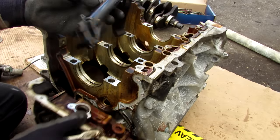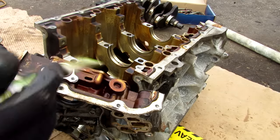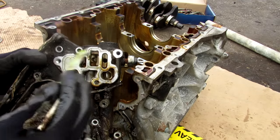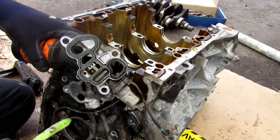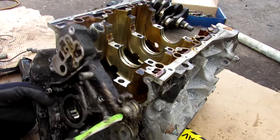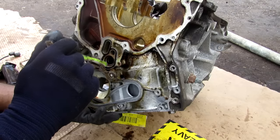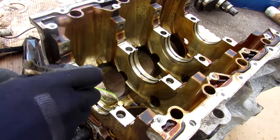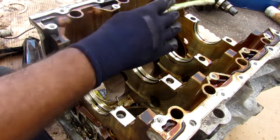Now let's take a quick look at the oil lubrication system on this Honda engine. It's pretty straightforward — you've got the pickup tube bringing in oil from the oil pan, feeding the oil pump which creates fluid flow. That oil flow goes to the oil pressure switch, then over to the VTEC solenoid and oil filter housing. The VTEC solenoid is basically an on-off solenoid that directs fluid flow to complete a hydraulic circuit and activate VTEC. The oil pump housing has a passage that leads up to a hole in the block — not only does that oil feed the block, it also feeds a secondary circuit for VTEC actuation. The main oil galley runs down the middle of the V engine, and then we've got the secondary circuit for VTEC inside the block. That main oil galley operates these little piston sprayers to lubricate the piston walls, and also feeds holes to lubricate the main bearings and the connecting rod bearings on the crankshaft.